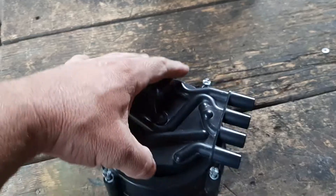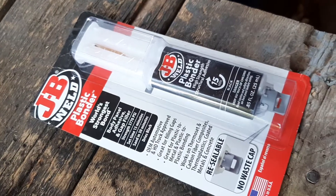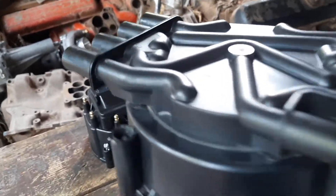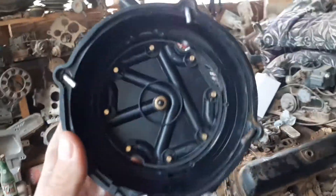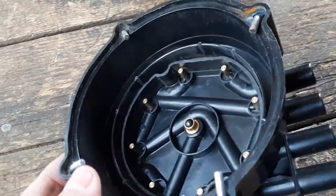You're going to want to glue it — you don't want water or dirt inside your distributor. The best kind of glue to use is JB Weld plastic bonder black. This glue is strong; it lasts many years, dries nice and smooth, and doesn't dry lumpy. This distributor cap has already been run on a car and you can see it's already been glued. When you put these two caps together, you're going to see some gaps you'll want to fill in. I prefer to use brass terminal caps — that way they last a long time.